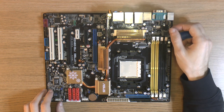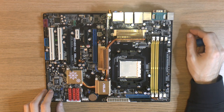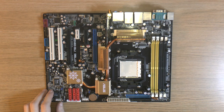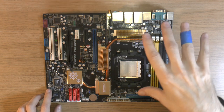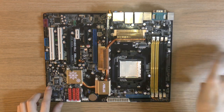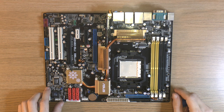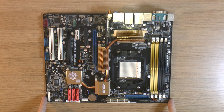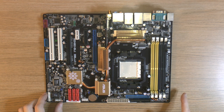Motherboards, I don't know what they're doing with the VRMs anymore. You have some big plastic LCD over here and a big heat sink. It only traps heat because the fins run into nothing. I don't know what to do anymore with that. I do like this setup because this actually works. If you have a tower cooler, it can blow over that and suck the heat out of everything. Or you can have a top-down cooler that will exploit both of these. You can obviously have a tower cooler going this way, sucking some air through there. And it's a pretty convenient way of cooling your motherboard components, chipset and VRMs. Today they seem to throw more plastic and metal, aluminium plates over everything, just trapping heat. So yeah, that's the motherboard we're gonna use.